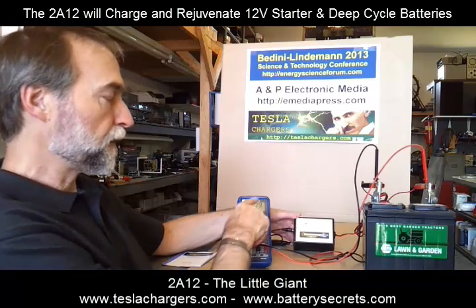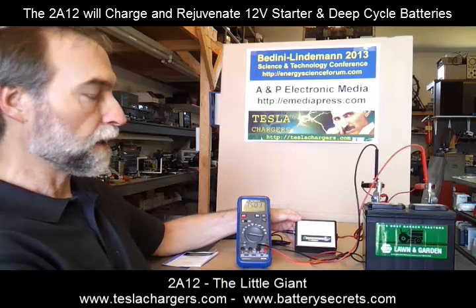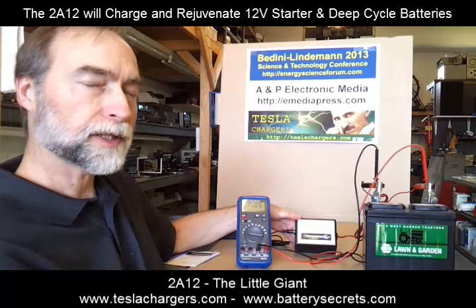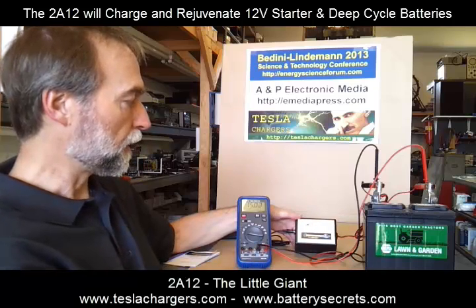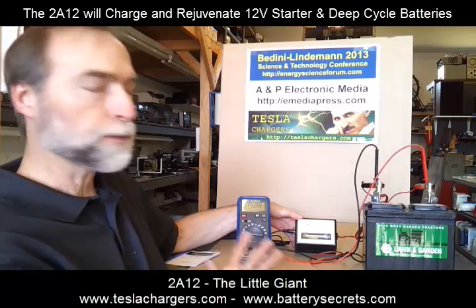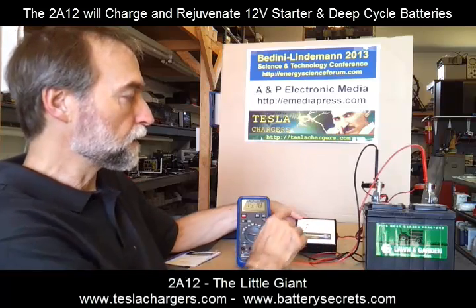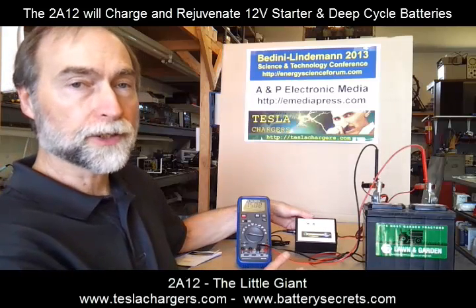By the time you get up to 15 volts, you're probably a volt higher than almost any other commercial charger would push the battery, and so it's got a lot of power in it right now, but the chemistry isn't quite finished — which is why it's still working on it. If you get it to this point, it's perfectly fine to take the charger off and use it. But if it goes all the way to a solid green, then basically the battery is pretty much finished.